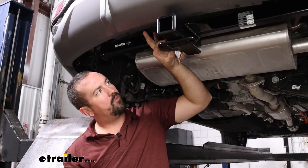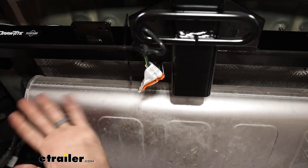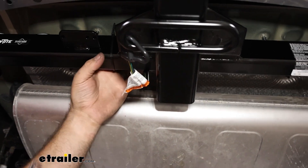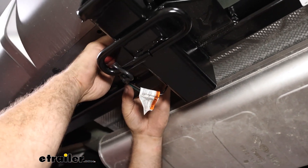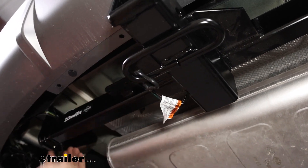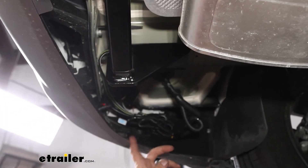I began by putting my four-pole — I just used the dust cap to loop it on the safety chain loop, and that way it stays in place. You can see where I'm cutting my zip ties. I zip tied it up to the top of the hitch, which makes a nice easy path over to our plug, and I just routed it this way and bundled it all up.